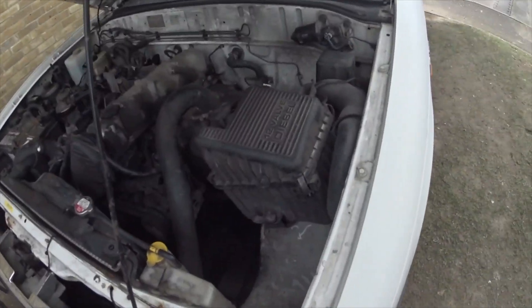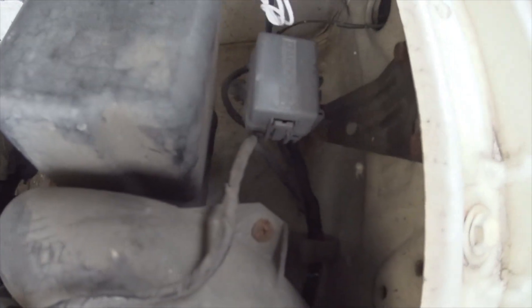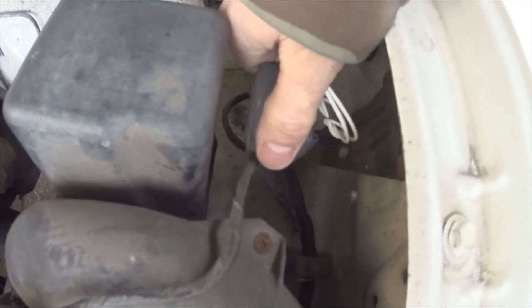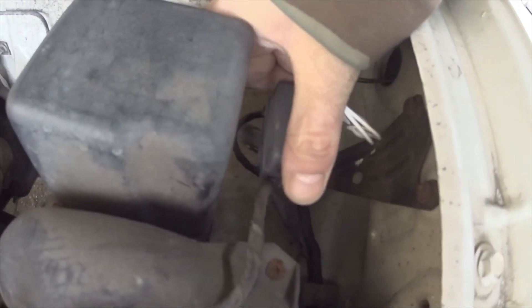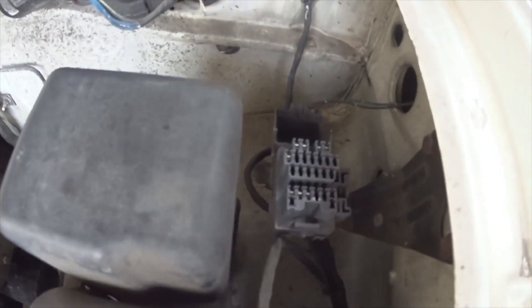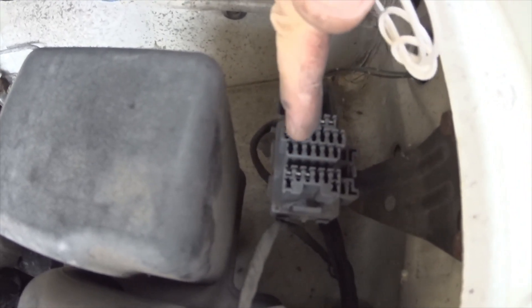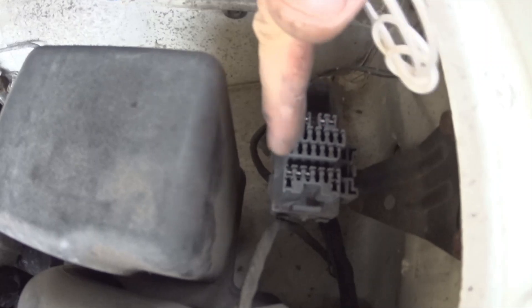You won't be able to use an OBD2 scanner or anything like that with these because they don't use OBD — it's just simple electronics, Mazda's own system. Pop the bonnet; underneath near the airbox near the wiper motor there's a plug labelled 'diagnosis'. You'll see some pins — not all of them are in there, you've only got four: pins one and three.